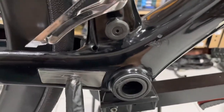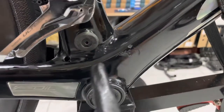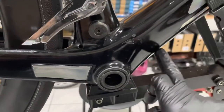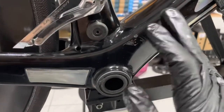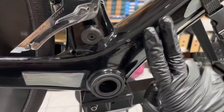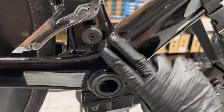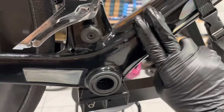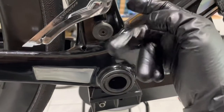So almost this is useless — they might as well not put this here because it's really not doing anything to protect the upper part of the frame, unless they were going to put metal all around here. If you clad all this in metal it would be fine. If you have a metal bike you don't have a problem; carbon needs to be protected. Something you can do as a customer if you have a carbon bike when you get it new is put some kind of tape or frame protector on the inside behind your crank, just in case your chain falls off.